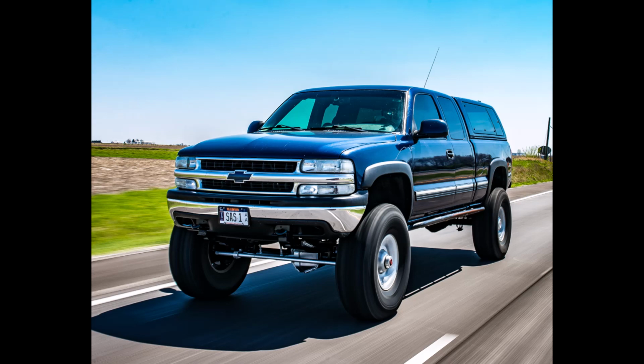I mean, I didn't change that much, but from what it was at roughly 10 inches of lift, now on 6 inches of lift, everything just changed. The wheelbase and the new anti-wrap that's longer. Did you see my burnout video? Yeah. Checking that anti-wrap. She just stood up about 1.5 inches and just lit them up. I was like, well, it works on 30 psi. When I get everything done with this back end, I'm going to air it down to about 12 or 8 and go back out there and do it again.